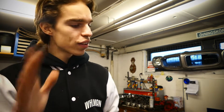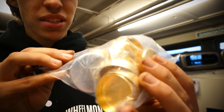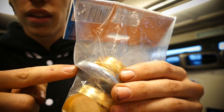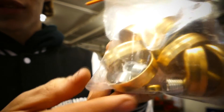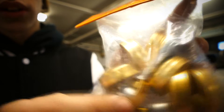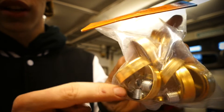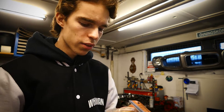Here comes a little something for the engine, though it's nothing big. We have core plugs in brass metal — these things are really nice. The silver one is the back plate for the cam, and then we also have all these smaller screw-in plugs for the oil galleys. Really nice quality — gonna get the machine shop to install them properly, or maybe I'll do it myself.